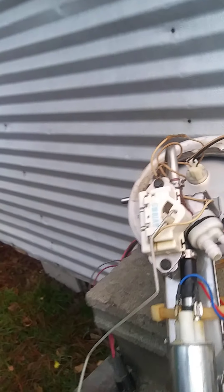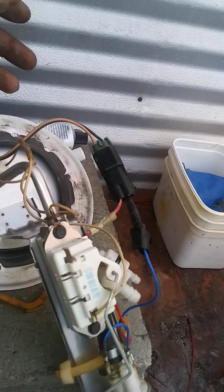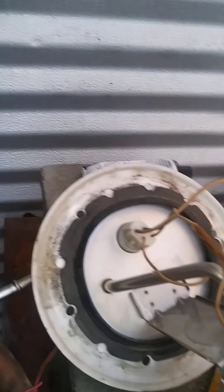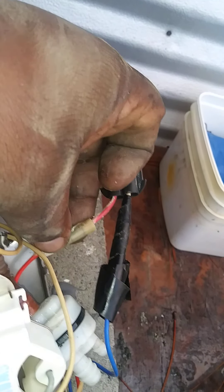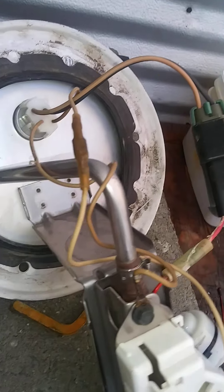As you see, it's broken — it don't even have the piece that goes there on there. So somebody already had done some rigging up. See, with gas and stuff like that I don't fool around — I don't do any rigging up, especially inside a gas tank. That's like a bomb, man. You're gonna buy it already original wired up correctly. Don't use butt connectors — you solder the wire and heat shrink it. Look at that tape, man — you don't do that.